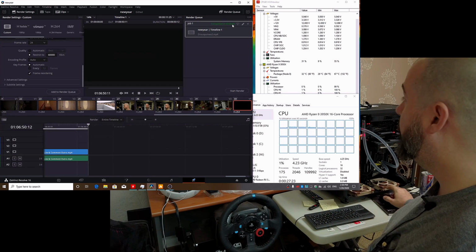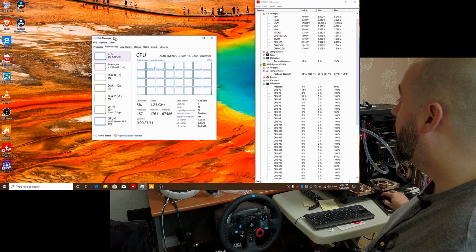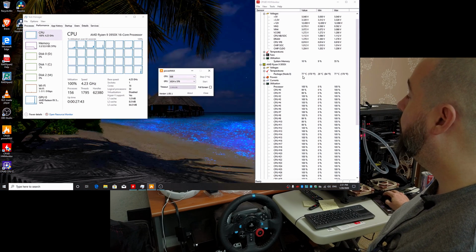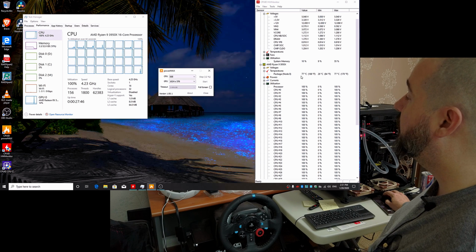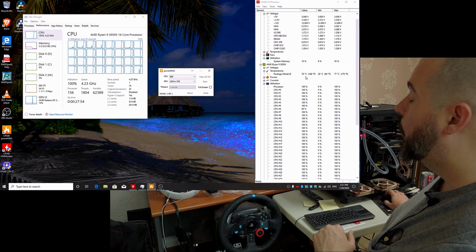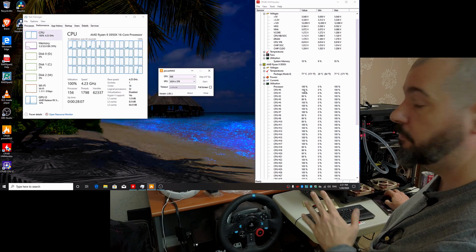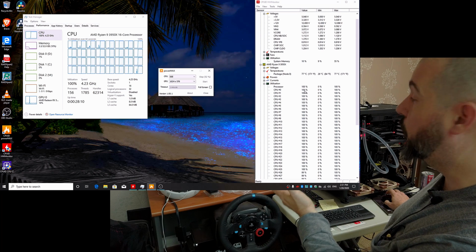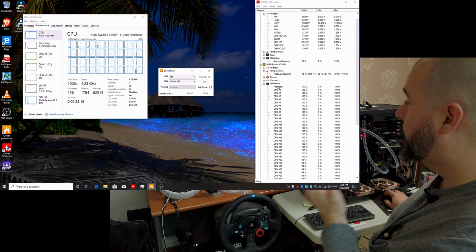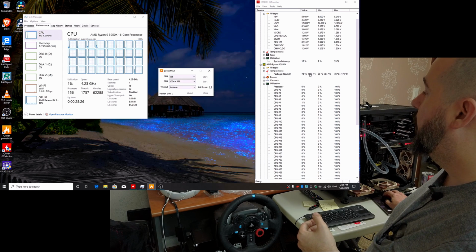So one thing that I have noticed, let me minimize this down here, or actually I can close that out. So our little stress test program from before, when I run the SSE, the temperature here will jump up to about 77, 78 C, 76. And at the 1.275 volts I have it at, this will run stable. Obviously my DaVinci Resolve will run stable at this. I don't think it got it over about 64 C, which is perfectly good. So this will run the entire minute of the stress test with no problem. So let me stop that and I'll let this cool down again real quick.